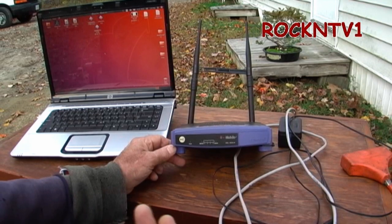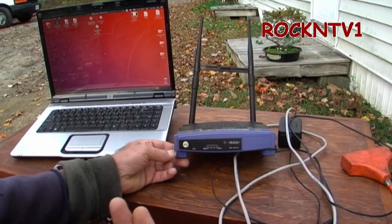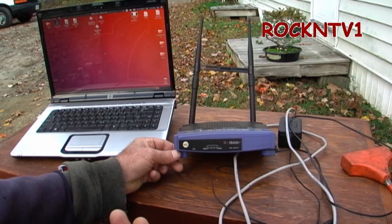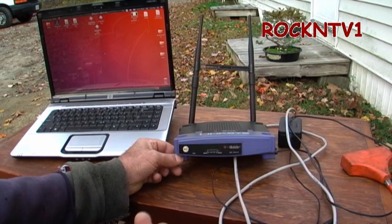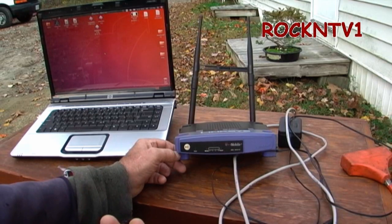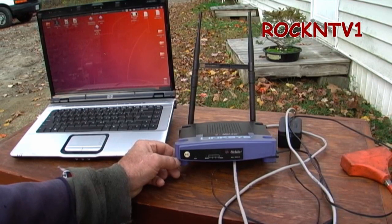If you're not ready to flash a router, then this may not be for you. However, if you can read instructions, follow instructions, and do some basic functions — like sending the firmware to the router across a LAN cord via a Telnet connection — then you'll be able to make this happen for yourself.